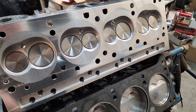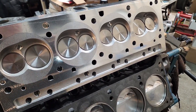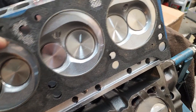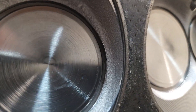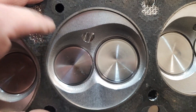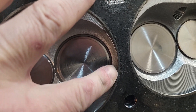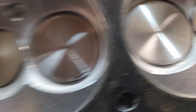Well, here's the reason why you can't just use a 301 head gasket. If we flip this gasket around and put it on the Kaufman head and line up the bolt holes — the biggest problem is that the fire ring, the hole for the cylinder, is not big enough to cover the combustion chamber. It's actually to the inside of it — the fire ring is overhanging into the combustion chamber. Now this one's not as bad, but it is an issue. These being smaller combustion chambers, it's probably a little better.